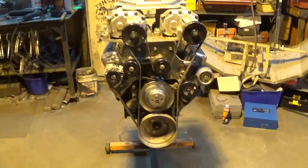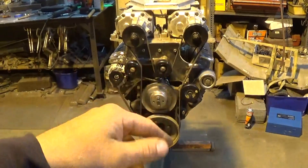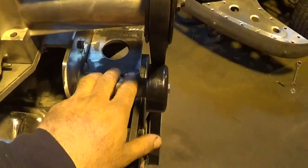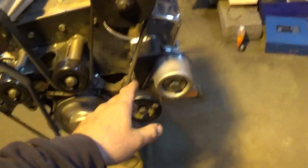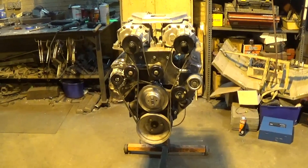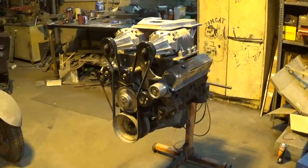Pretty much the next order of business is moving the tensioner back down to this side. I'm probably going to take this idler pulley off and put it over on this side to get that belt to come in, to get my wrap on the top and on the bottom and get my surface area back from when I remove the tensioner. When I put the tensioner here it'll push in here and I'll gain this back after removing this. Basically when I do that I think I'm just going to cut this solid standoff off flush with the front of this bracket and just make a whole new one for this pulley to put back over here — probably somewhere right above this bolt to push in up here. I've got to pull the heads off the car, get the engine block down here we're using, and we can basically start putting this together after a little bit more work on it. Thanks for watching guys, till next time.